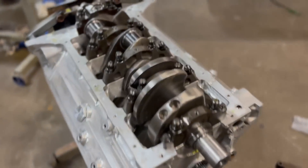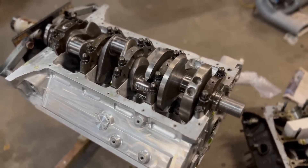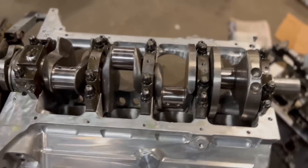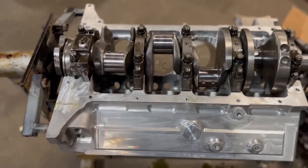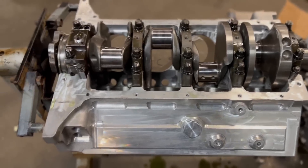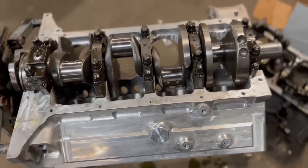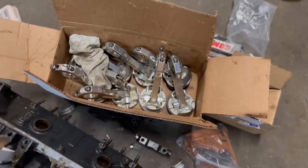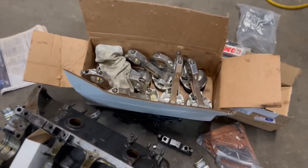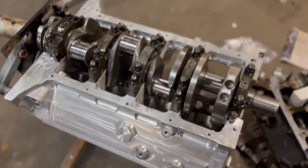That's going to wrap it up for today. I'm very happy with the progress — we got the crank in. My plan was to file fit the rings today but that's just not going to happen, it's time consuming. So tomorrow I'll get back over here, file fit the rings, and then basically put the bearings on the rods and snap it all together. The pistons are already on the rods so there's not much left. Comment, like, and subscribe — see y'all soon!